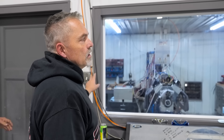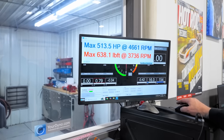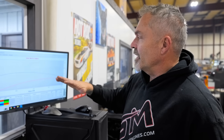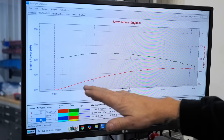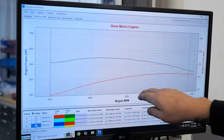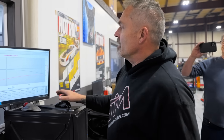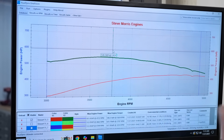It is deadly consistent in horsepower and torque. We've been making a bunch of pulls — it repeats like crazy. Here's Ignition B — the forward spark plug, which is forward of where the old spark plug was. Looking down on the chamber, the forward plug with no change in tune-up, mechanical injection position unchanged, timing verified the same — this configuration makes 546 foot-pounds of torque and 431 horsepower.